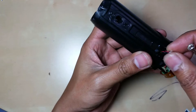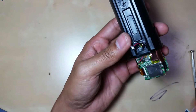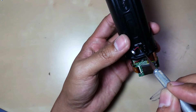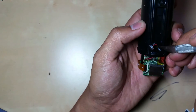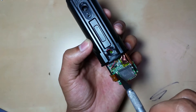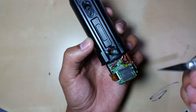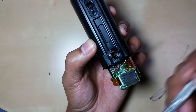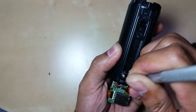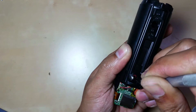The microphone is bigger than the gap inside the body, so how do we remove it? That's when the precision knife comes in — we'll make the window opening bigger to let the microphone through. Alternatively, if you're handy enough, you can unsolder the tube port and take it out, but I don't want to touch the PCB, so my choice is to cut a small window just big enough to send the microphone out sideways.